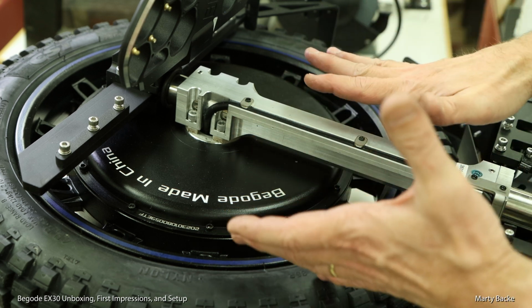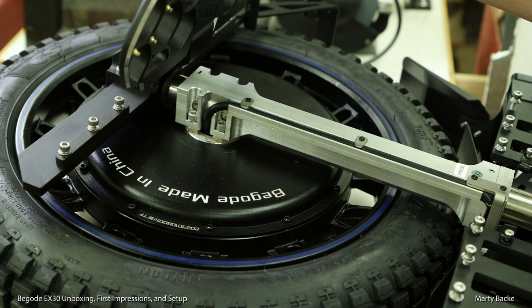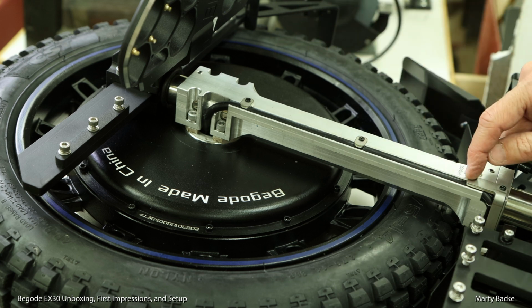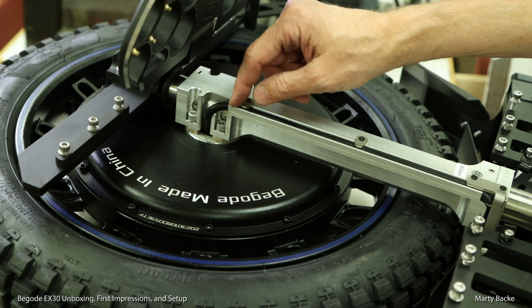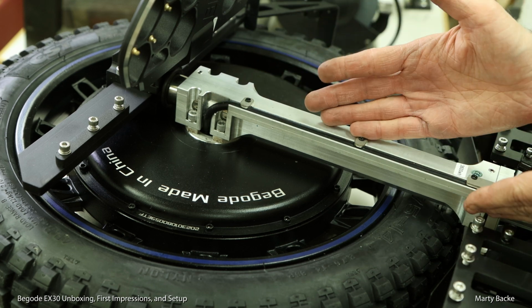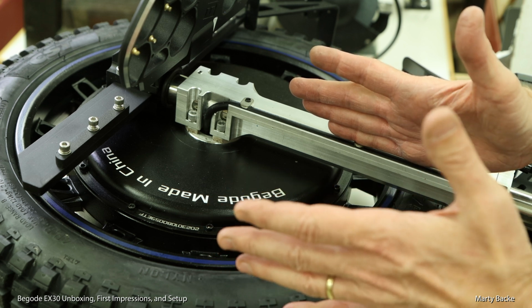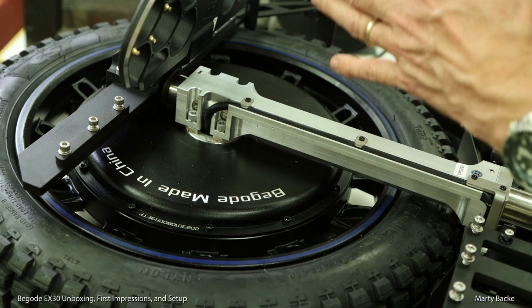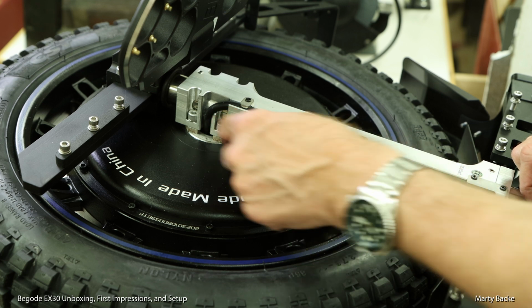So you're going to remove those, flip it over in this configuration. You're going to remove the 3 that you can get to. You might have to remove the pedals to get your wrench down there. That varies. You're going to have to remove these 4 screws so you can get these tabs out of the way to allow the cable to freely move. Then this one battery you will most likely have to disconnect only from the frame, and you should be able to just move the battery over and lay it on this battery resting here, and then you'll have access to this bolt with your wrench.